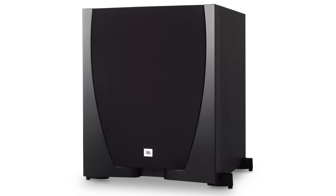The people buying this speaker are going to be home theater enthusiasts — I don't think two-channel enthusiasts are buying this particular brand. I paired it with a JBL 550P subwoofer and played around with positioning and crossover points from 60 to 120 Hz. What I landed on was between 80 to 90 Hz, which worked best for my needs and the room. If you go lower than 80 Hz, these speakers barely get there on their own. My personal suggestion is to stay between 80 and 100 Hz.